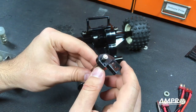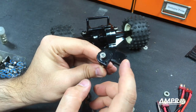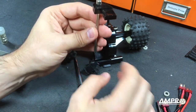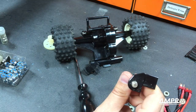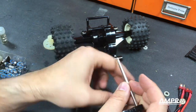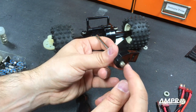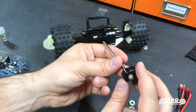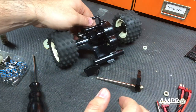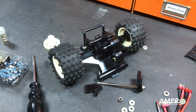Unfortunately we're stuck here until we redesign this pivot pin — there's really not much else we can do. Please stay tuned; the next video will be of us putting the transmission in the car with a redesigned pivot block. I have a spare one of these but I don't want to use it because I don't like the idea of having to pound this sleeve back onto the shaft. My plan is to create one of these retainers that will encapsulate the entire shaft so the car will be much easier to disassemble in the future. Thank you so much for watching — we'll update the bracket and finally see this Neko in action. See you all very soon.